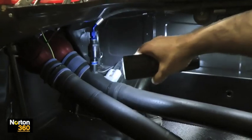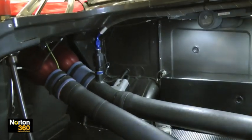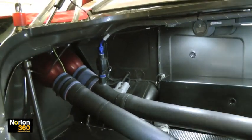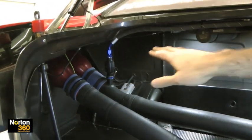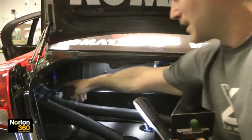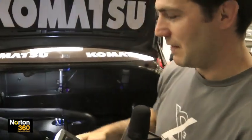If you come around and look right in here, you'll see this valve sitting on top of the filler. Obviously when you use fuel you're sucking it out of the bag, you have to replace it with air. So that's your valve to let air in, but it's a rollover valve so that if the car rolls over, fuel won't be spilling out of that valve.